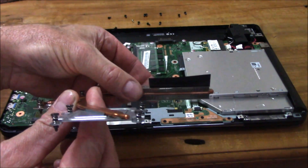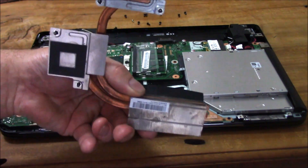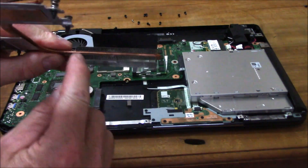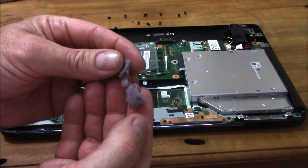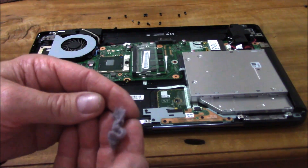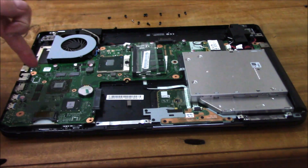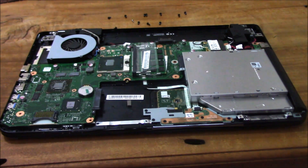I've got the cooling section off here. This is where the CPUs face — I've cleaned off the thermal paste. But one thing I did find in behind these vents: I found a whole heap of dust bunnies. Now that's going to create overheating — if the computer can't get rid of the heat, the heat stays in the laptop, increases the temperature on the CPUs, and therefore the laptop wants to shut down, giving us the blue screen of death in this particular case.